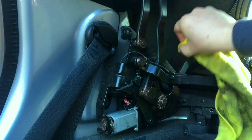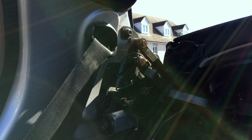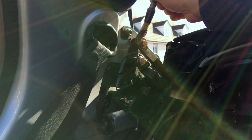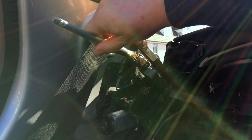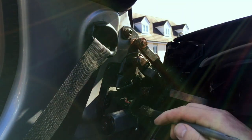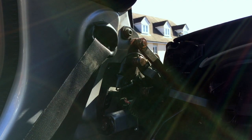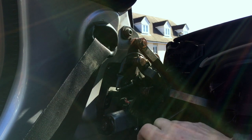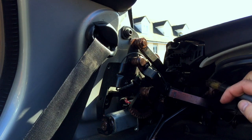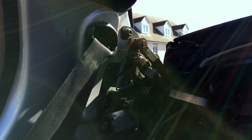There you have it — that's pretty much most of it done now and cleaned up. I'm just getting the extra bits with the roof retracted. What I would do is put the roof up and down three, four, five times as you're lubricating these joints, just to aid it to get in there. If you want to be really pernickety about it, in between each couple of raising and lowering motions put some more grease on and wipe it off, just so it gets in between those crevices.